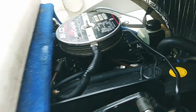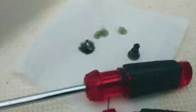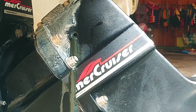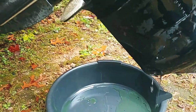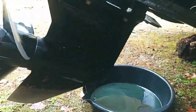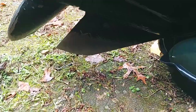Remove that cap. The vent cap is loose, and I've got those two bolts removed. The top one — you see that there's stuff coming out there, so I had to be sure to catch it down here. And then the bottom one — we just want to let that drain. Be sure you catch it all. The trim is supposed to be down pretty low, so I put the motor down about as low as it could go and still be able to catch the oil here.